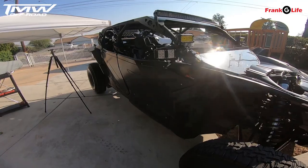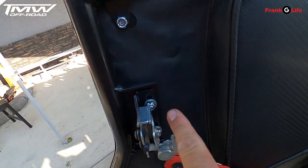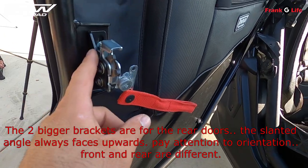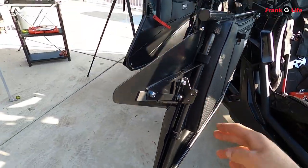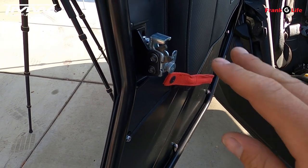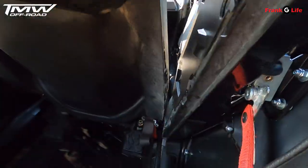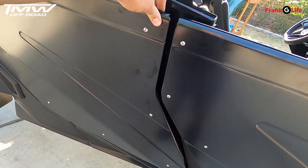Same thing for the front. This car just looks so much better with these doors. So I put on the bracket using a washer and nut for upper and lower, and then you just use the existing hardware from your latch to bolt your latch onto the bracket. The bracket is different on all four corners, so the way it's orientated is different on the front versus the rear — make sure you look at the instructions; I'll leave a link below. It is a little tricky, but if you look at the instructions, it'll be clear as day. I left these slightly loose so when I close the door, if I need to adjust it, I can. It looks like it's not binding, so I'm going to go ahead and torque them down.